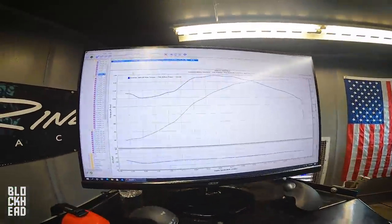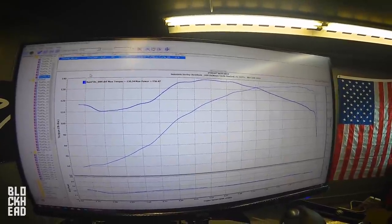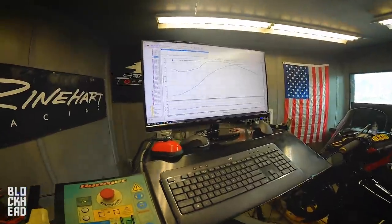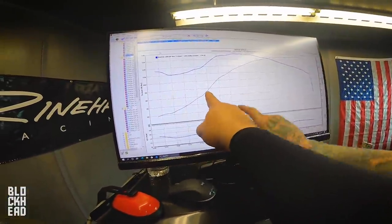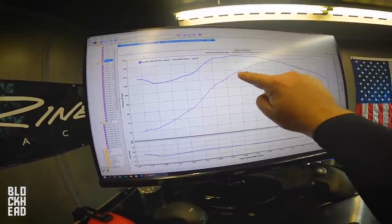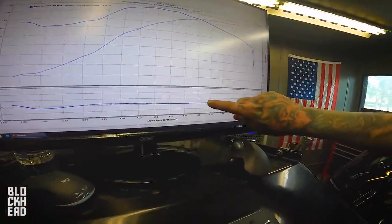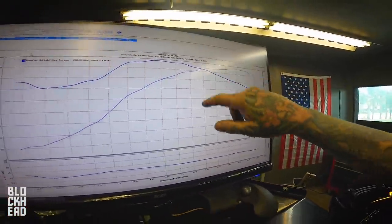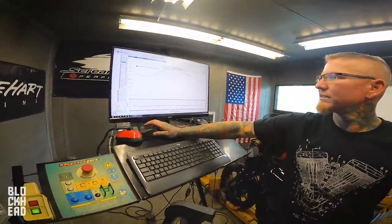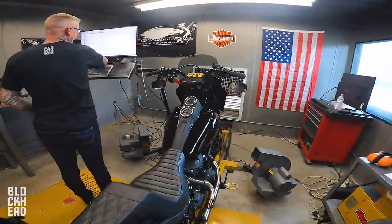I'm impressed. Again, I think we've said this a couple times, but for not tuned, out of the box, that's pretty clean. Then on the interstate, you gotta be up around 35. You feel it here, you start to feel it here. And then your horsepower, if you were out there screwing around at 5500, that's where you're in that horsepower. Definitely a higher end RPM cam, as a heads up. We're gonna have some new fun with that 6500 red line now.